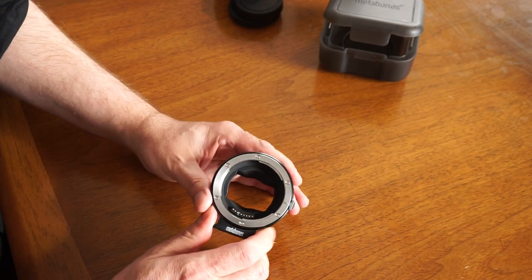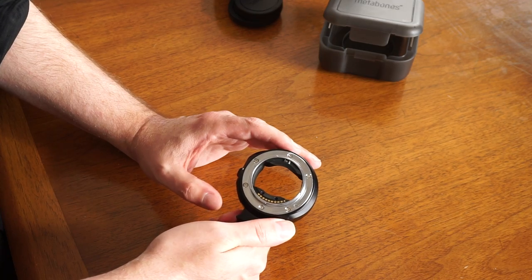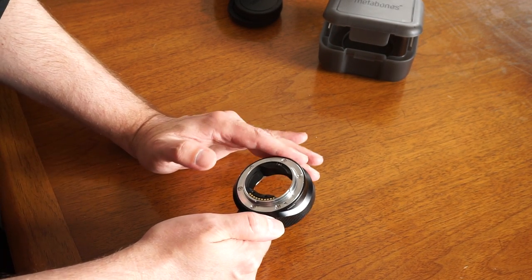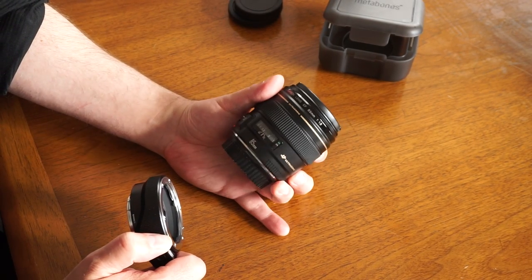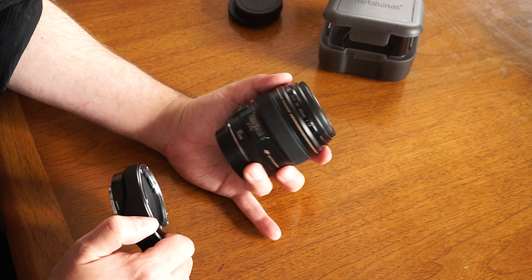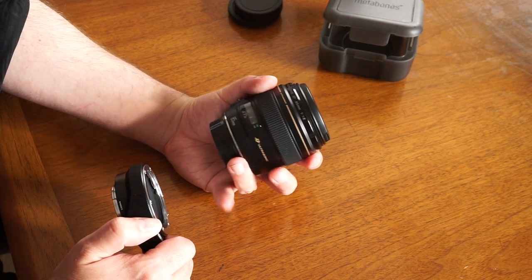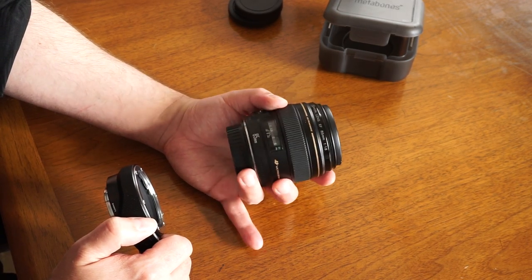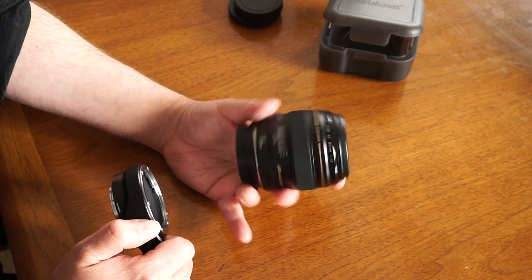Basically what you're seeing right off the bat is the electrical contacts, and they're on the backside as well. There is circuitry inside that translates information from the Sony camera to a Canon lens that does not have an aperture ring that I can turn. So if you don't have this adapter and you're using Canon lenses on a Sony camera or micro four thirds, you're going to be limited to shooting the lens wide open. You're not going to get any of the EXIF data that comes off the lens telling you in Lightroom what focal length you used or what aperture you set.